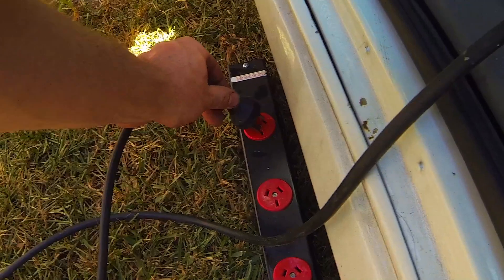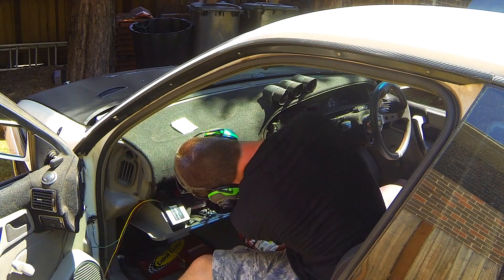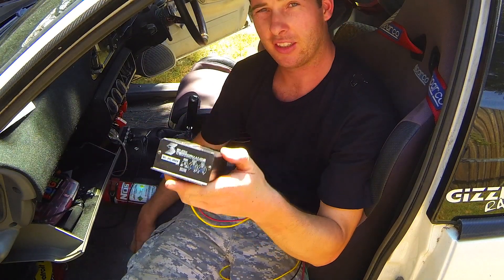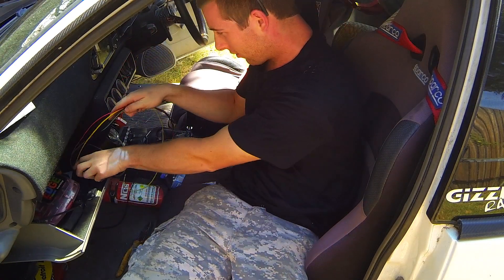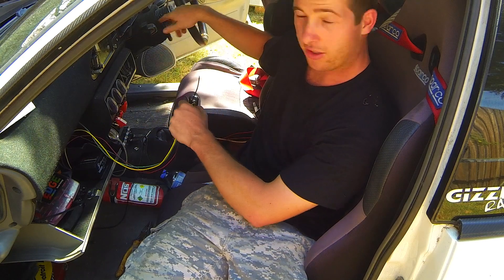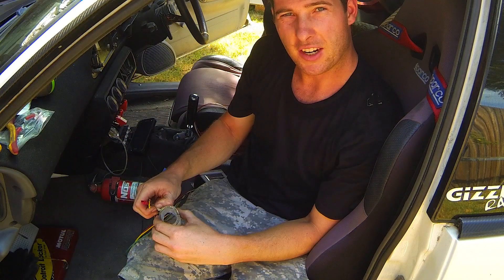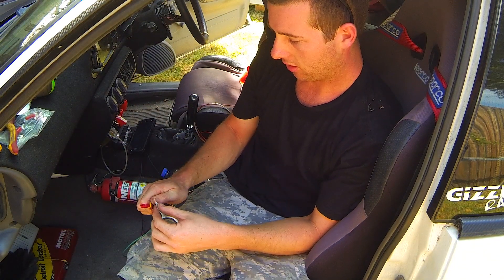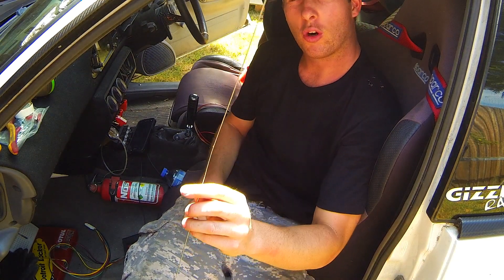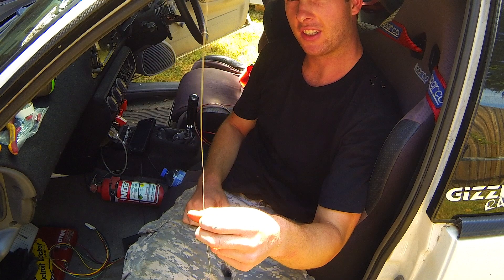How's this for a plug board? In a nutshell, I'm going to have this mounted in the glove box. The wires will route back across the dash under the driver's footwell where I've got all my other wiring connections. This is my go-to for pulling wires through tight places, especially on cars — just a TIG welding rod, this is stainless, 1.6mm.